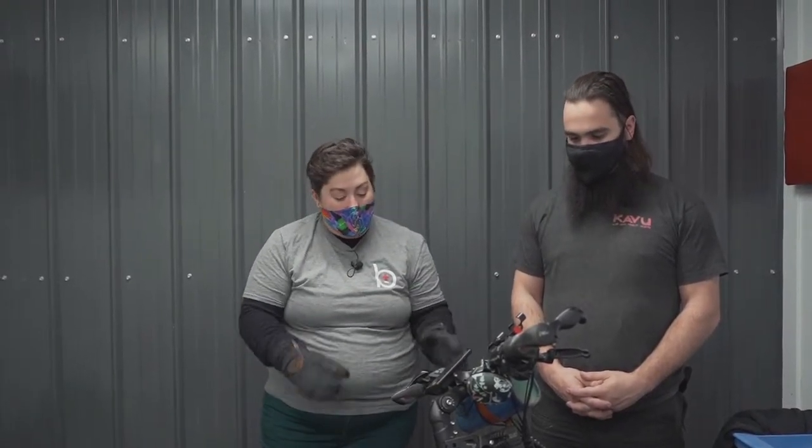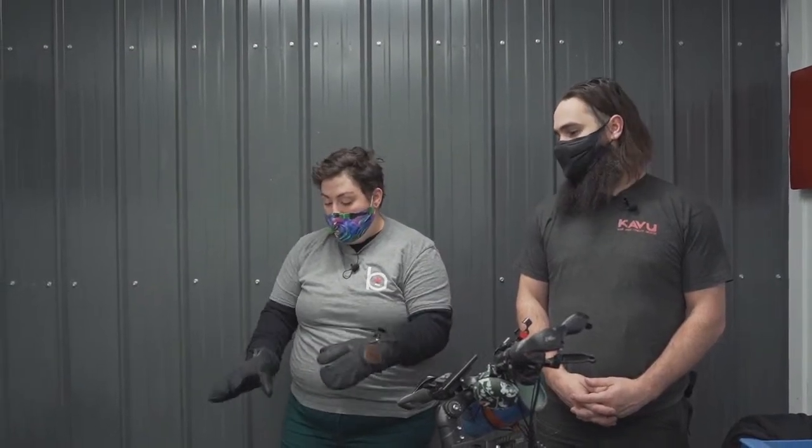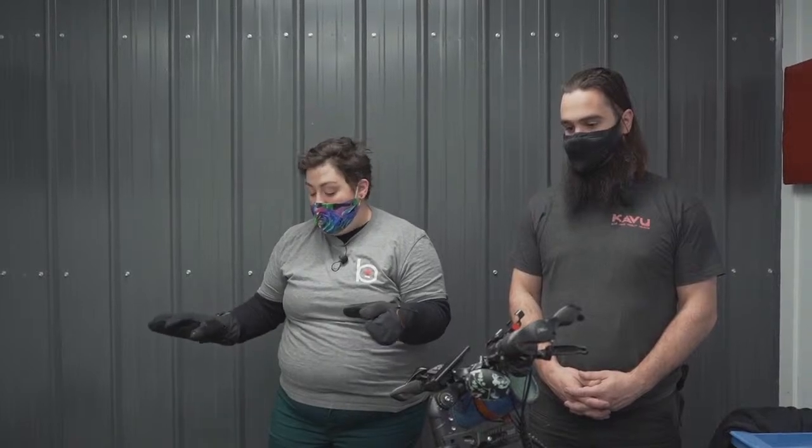Sweet. All right. So take my batteries off, charge them at room temperature. Yes. Lower PSI. Maybe consider studded tires if you can find them for your bike. Yes. Lube and dry and clean your chains. Maintain your drivetrain. Wipe down your bike. Dress warm. Yep. What else?